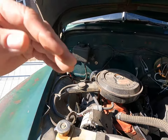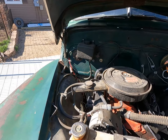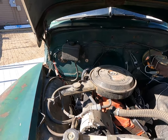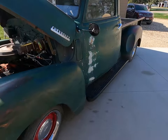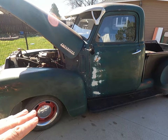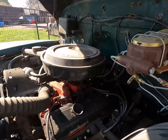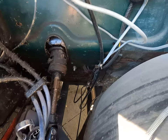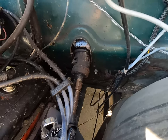I followed a guy on a message board who did this project and documented it really well — I followed his suggestions closely, including CAD drawings of how to do the frame mounts and where to mount it on the S10 frame. This is a '96 S10 frame, so it's a second generation S10. I've got two-and-a-half inch lowering spindles in the front with two-inch lowered springs, and three-inch blocks in the back to bring it down to where we wanted. You can also adjust how you mount the cab on the body mounts. I mounted it so my floor is flat — I didn't have to do a lot of floor work and there wasn't a lot of rust-through issues.